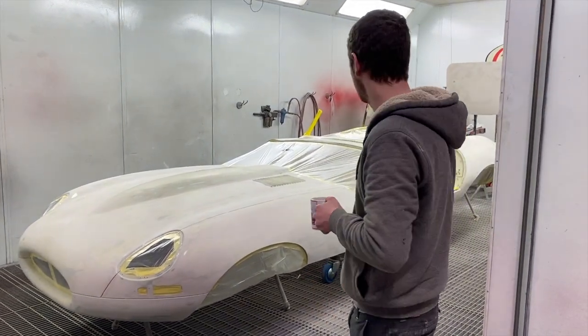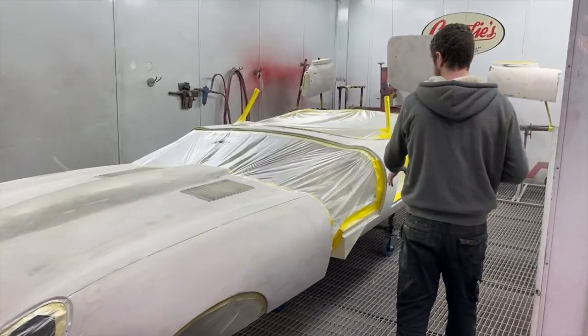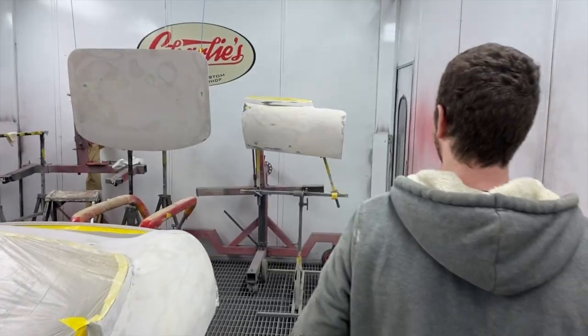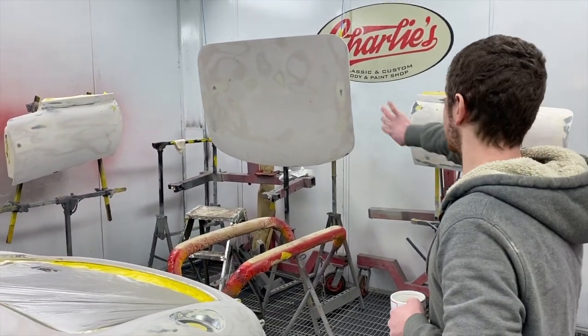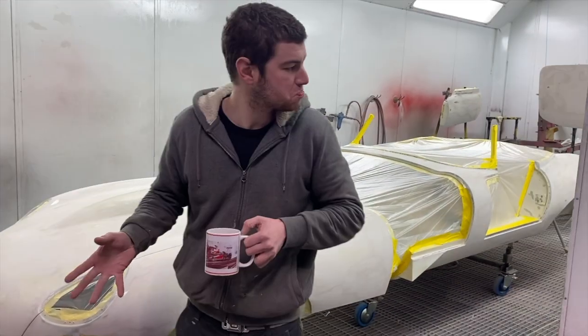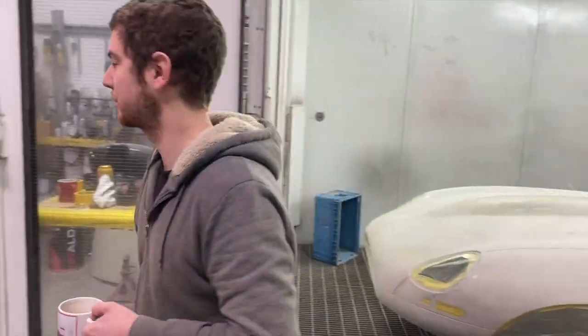The filler work is done. We've taken all the panels off, so we could sharpen up all of the edges around the doors, and we've just polymasked it, because it's a quick way of masking. I'm gonna just take these last few bits out, the trestle and the steps and the things, and rearrange the panels, and then we'll get the polyester on. We'll end up with about 6 coats. Probably on this shell it's gonna be 7 litres, I reckon. We'll see how close I was at the end.